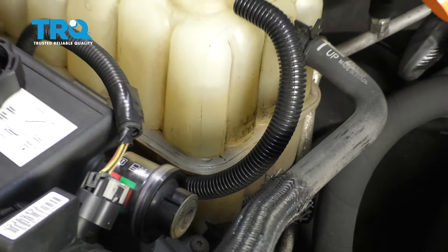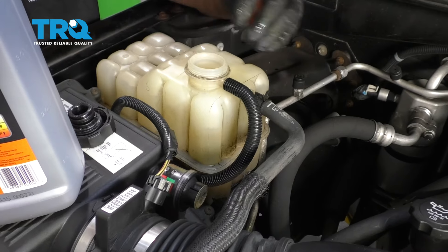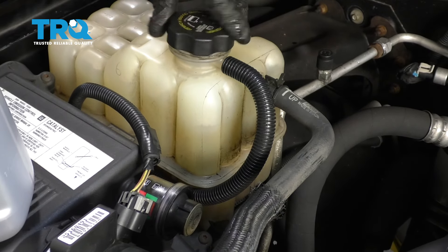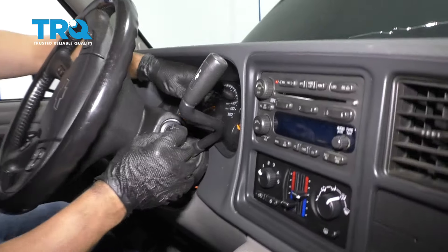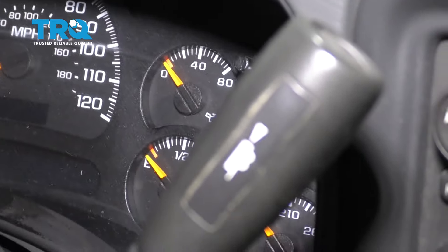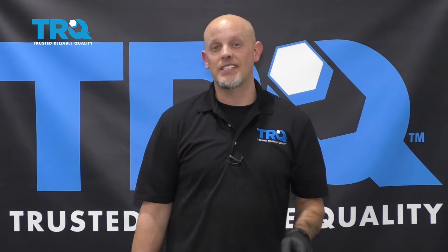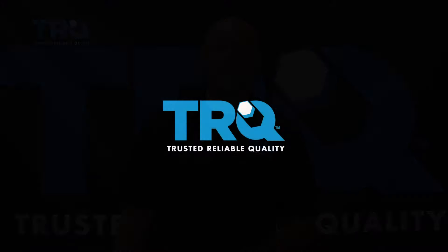Then you start the vehicle, let the vehicle run for about 10 minutes, monitoring the temperature gauge while you're running the vehicle, and monitoring the level. You're gonna want to top it off while it's still running. And once it's warmed up, shut the vehicle off, let it cool, put the cap on, and then after it's cooled, check the level again. Now when you first start the vehicle, you want to take a look at the oil pressure gauge and just make sure that comes up fairly quickly. Just watch that gauge — it came up pretty quickly. Now because we disconnected the steering idler arm, it would be a good idea to have the vehicle aligned after you're done.